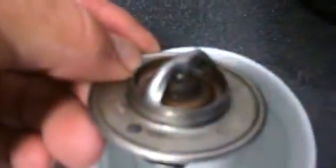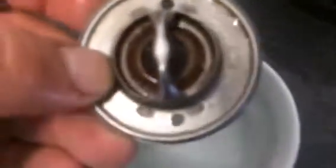Now I want to do another test. We'll pour that away - you can see the gap. Through the cold water, and the gap immediately closes up. So that is a thermostat in good working order.